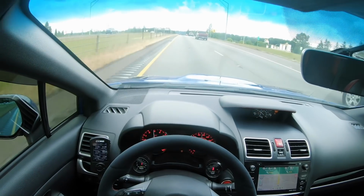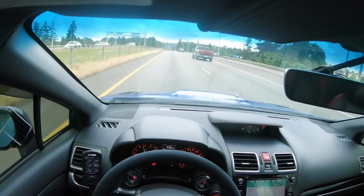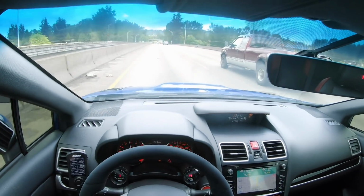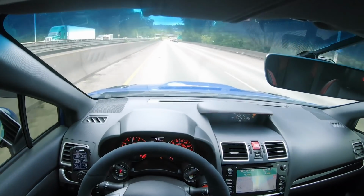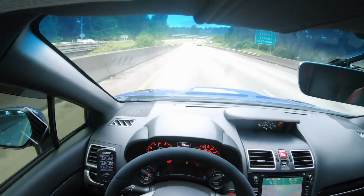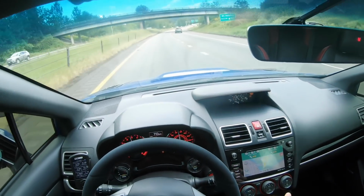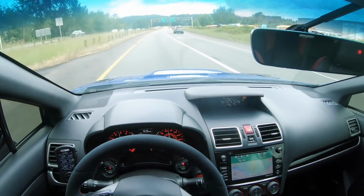Yeah, dude, it just picks up so good. So I'm just using the standard FP Blue. I forgot which trim size, but it is the cheapest, most basic FP Blue you can get. Now the turbo has more get up and go in it, but obviously we did stop the car at 400 wheel horsepower on the dyno just because we were running out of fuel pump. Now with that being said, if you are looking at one of these, just snag the cheapest one. I promise you, if you're on a stock block, get the base FP Blue. It's more than enough for what you'll be needing. If you're on a built block and you want more power, snag like an FP Green or an FP Black or something, but for this power interval, I think it's perfect.